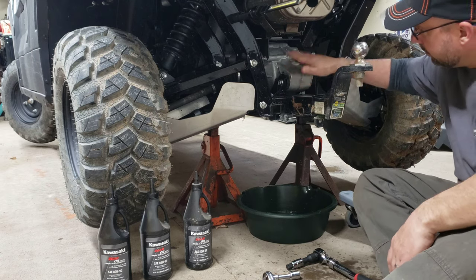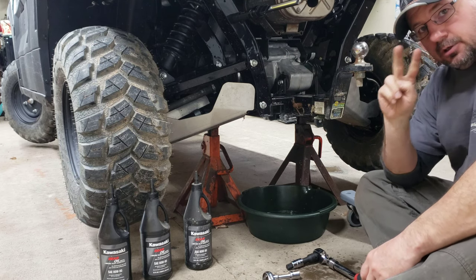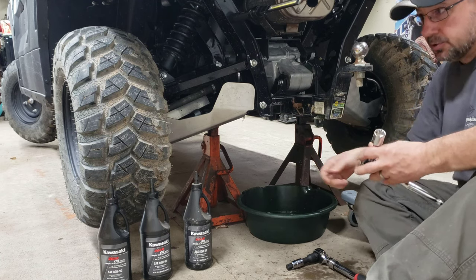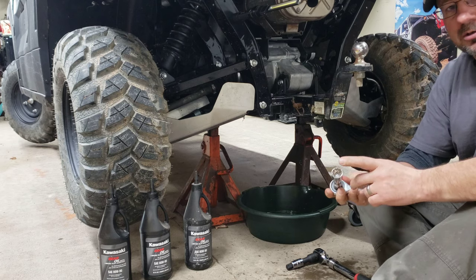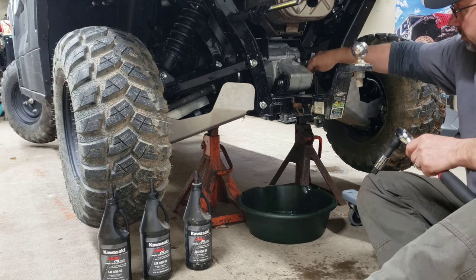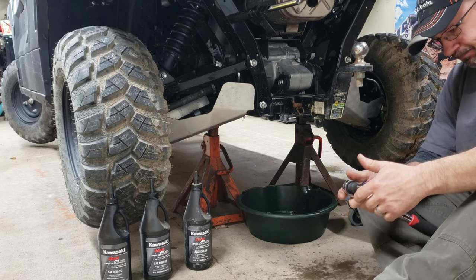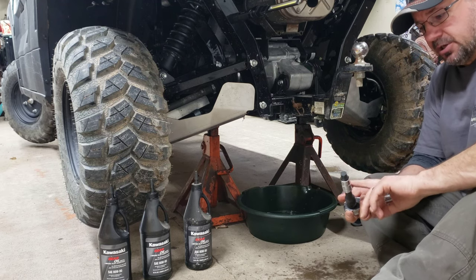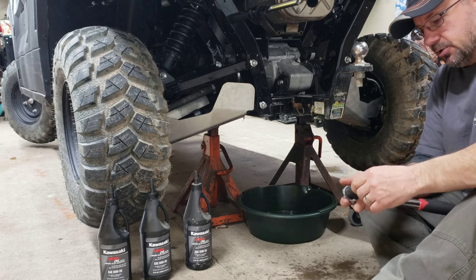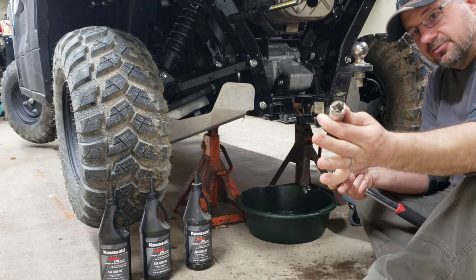Okay, so for doing the rear differential and transmission fluid, this is a shared fluid source, you're gonna need two tools coming up underneath the transmission up through a hole in your skid plate. You're gonna need a 17 millimeter socket and ratchet. That's for your drain. For filling on the right hand passenger side here, there's a plug here. You can go to Harbor Freight right now. These are $13.99 for a set of the 3/8 1/2 inch drive with the big ones that go up to, I think it's 17 millimeter or something. But anyways, you need a 14 millimeter hex.